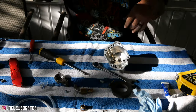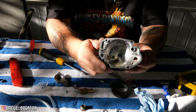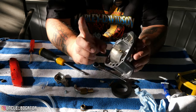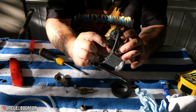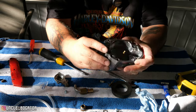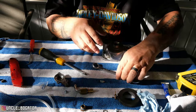I realized the sunlight is coming in at a really weird angle but I don't have a workspace out of the sun. I got this thing pretty clean — I should have highlighted where the dirt was collecting. One thing I did while I was out there: the accelerator pump has a slit — the guy Rocco called it a smiley face — and it points backward so it squirts gas. I stuck the cleaner through the little hole and made sure it sprayed out. It looks fine.